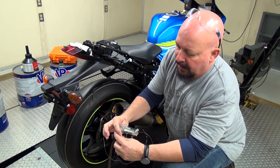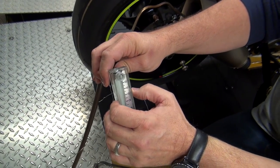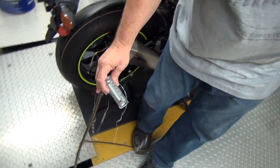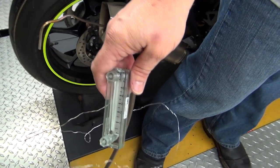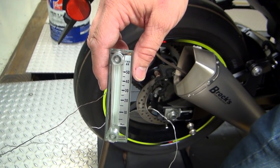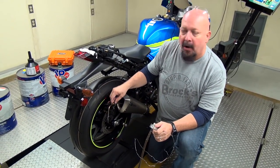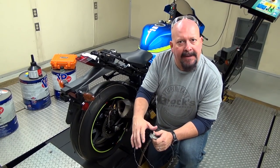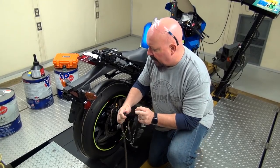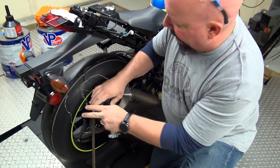So you want to use as long a probe as possible and put it way down in there. According to DynoJet we need to have around 35 liters per minute at around 100 psi. When you put a longer probe on it's going to draw some down, but we're right within range. If we're going to use a probe with the pump, we hook everything up and tie it in — that's how we get our air-fuel reading to tune from.